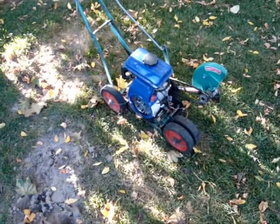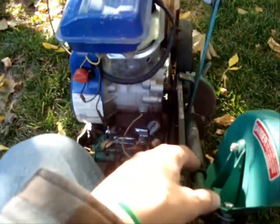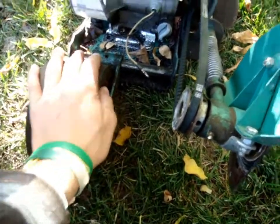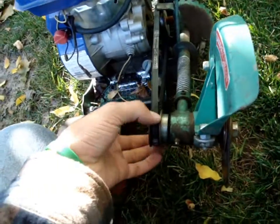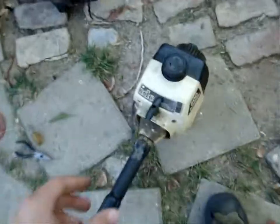I used that Arco engine to get this Power Trim running - I found which way the engine turned, made sure it was turning right, then hooked a belt up to the pulley on the Tecumseh, sat the Tecumseh down on these tires, pulled on it really hard and got this engine to turn over fast. It took a long time to get it running because of funny little quirks, but now this thing starts first pull every single time.